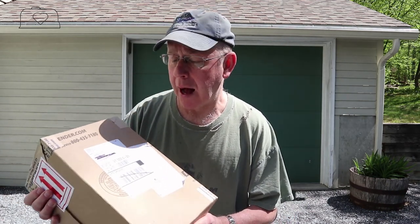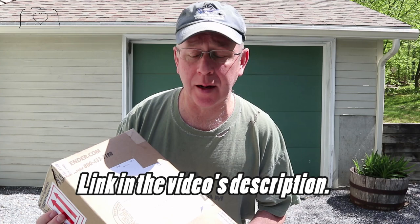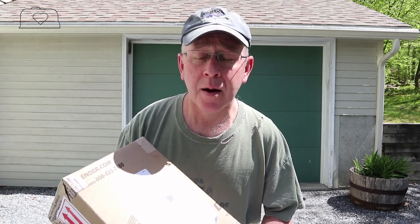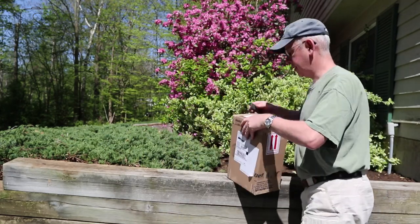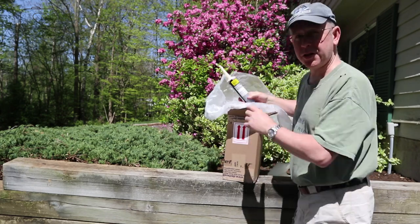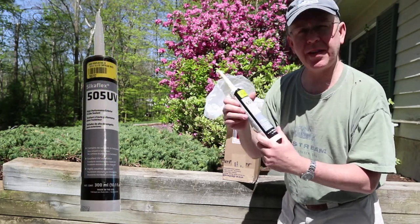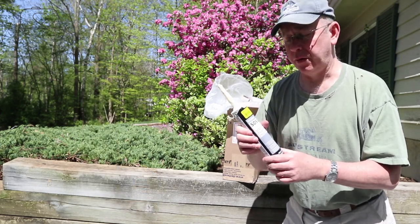My sealants have arrived! I ordered them on Wednesday and they came in on Thursday — 24 hours later from Defender.com, a marine and boat supply company. A good tip: sometimes if you can't find what you need in an RV store, marine companies sell very high quality products. They're expensive, but it's always another option. The best of the best is Defender Marine. This is Sikaflex 505 UV. The Airstream factory currently uses Adseal, but Sikaflex is what I've used before and it's what a lot of Airstream and RV owners use on their roofs.